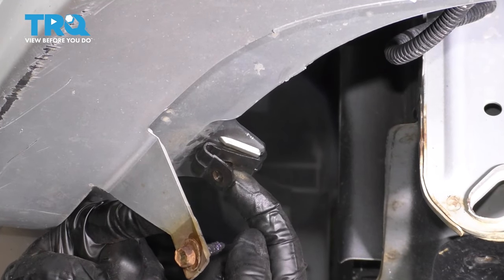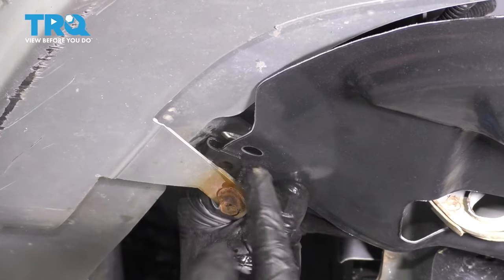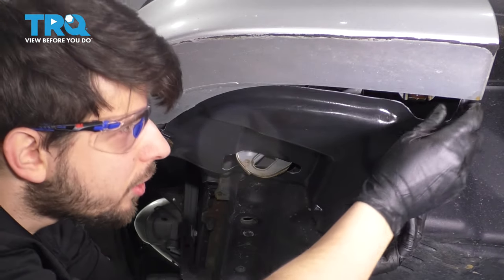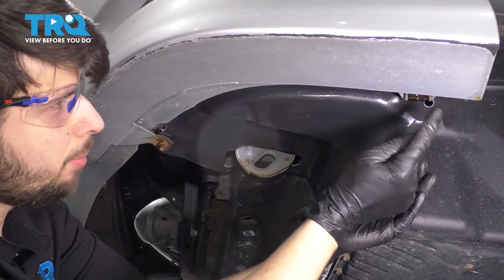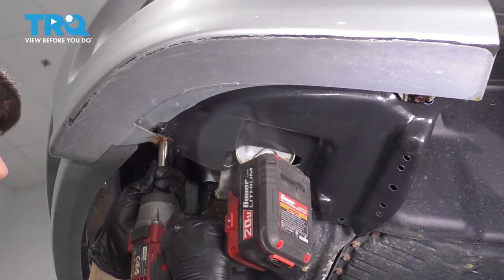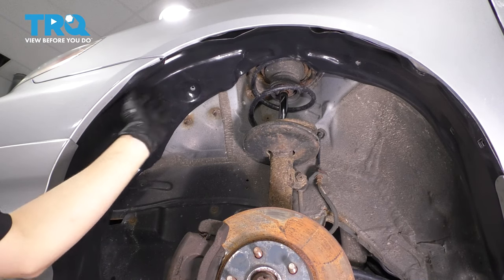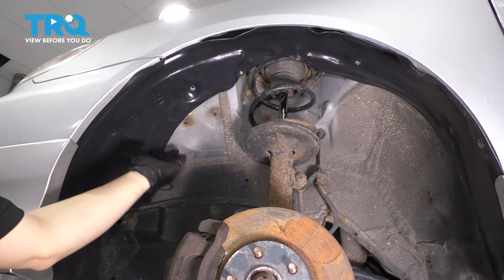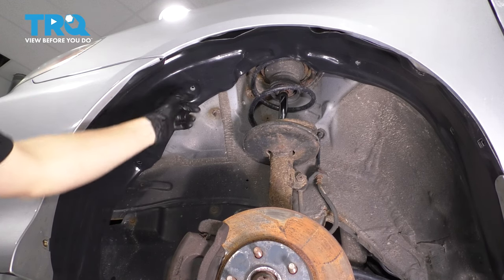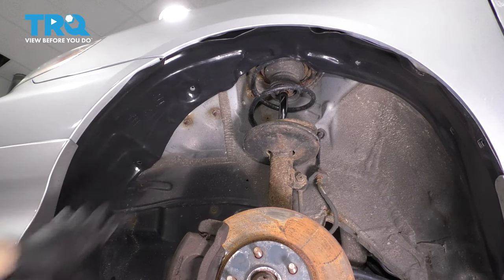When you bring it in here, you'll notice that these clips have a lip to them. Make sure that the fender liner slides in and basically gets pinched by this lip. Start the mounting screw, and we'll have to do the same thing on this side — except this one will go above the bumper cover, not underneath. When I install fender liners, I don't go in a specific order; I start with whatever bolt holes or clip holes line up. If I see one lines up almost perfectly, I'll put a clip in there because that means this area is positioned as it needs to be, so I want to lock that in. Then I'll move the rest around.